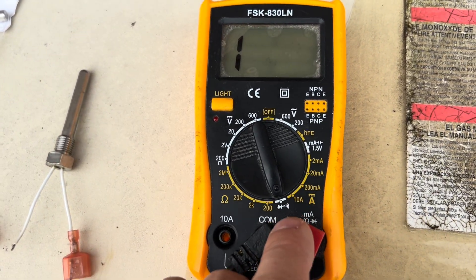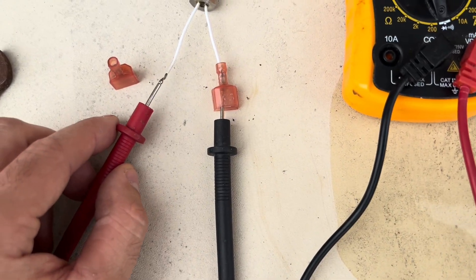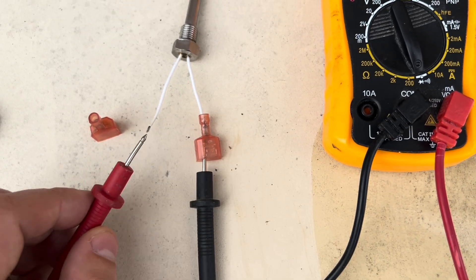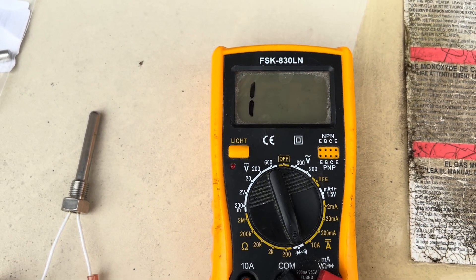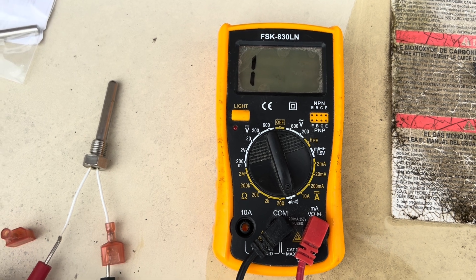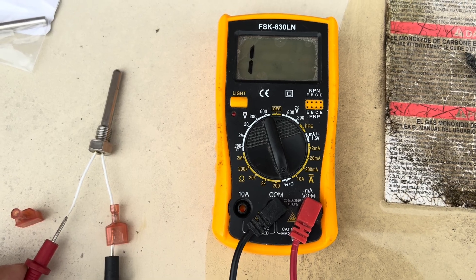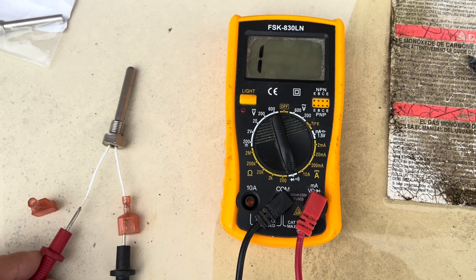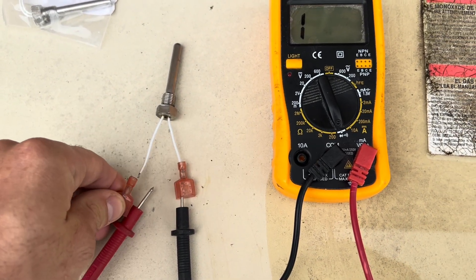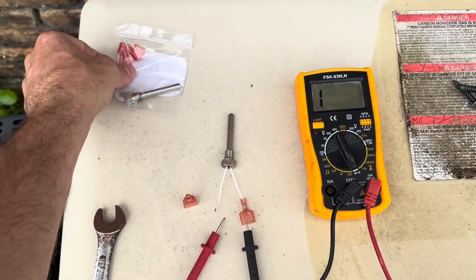But if the piece did not fall out and you want to check and make sure the sensor is a problem, what you can do is take your multimeter, put it on the continuity setting, and have this end touching that end — make sure it's a firm connection. You would probably get a beeping sound saying you are getting continuity, and that would mean your sensor is absolutely the issue. Mine's not getting that, so the sensor is not necessarily the issue — it's probably because this piece was loose and not a solid connection in there.